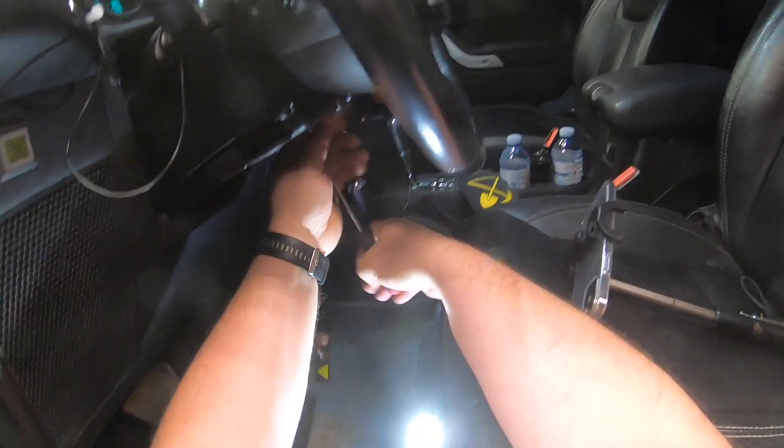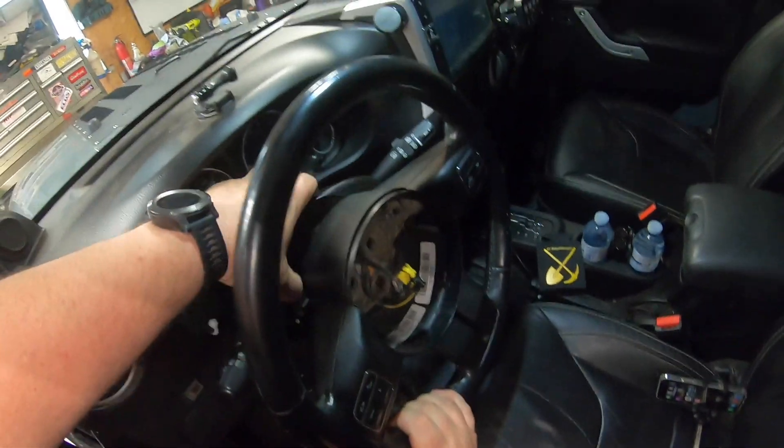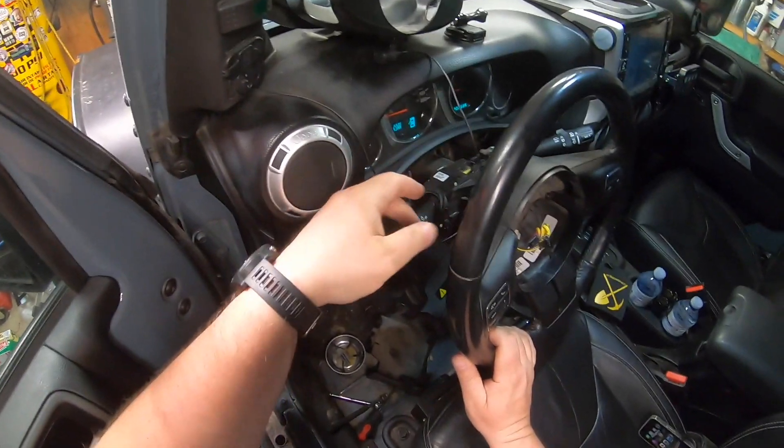You can see right now the cover is already loose. The last bolt is out — now you just grab the bottom cover, give it a yank, and it just slides right out. Then move the steering wheel down and you can fish the top piece out and put it up top or wherever you want.